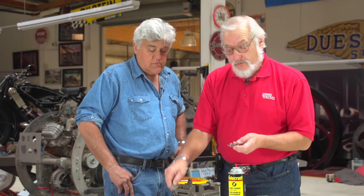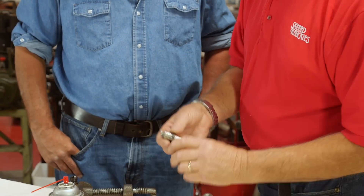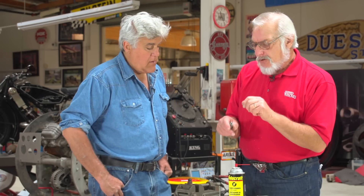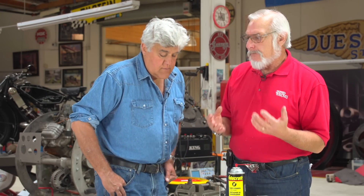Most spark plug gauges have a little tool so you can use it to increase the gap if necessary — or close it down very gently. You don't want to do it on a very hard surface; don't take a hammer and bang at it. Very, very gently — you're only closing it down a couple of thousandths of an inch. The bigger the gap, the harder your ignition system has to work, especially if you have a magneto. Owner's manual, service manual, Chilton's, Motor's Manual — they all give the correct gap for your car, subject to a little bit of variation.